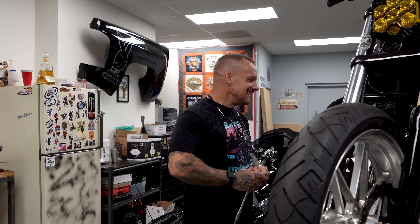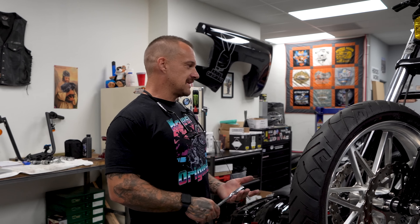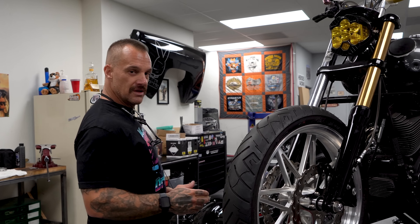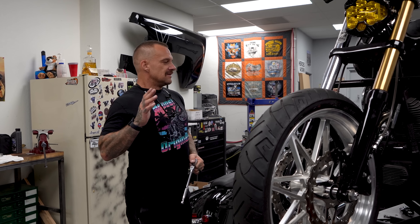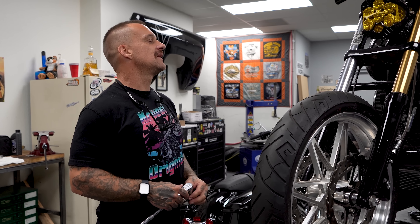It's been a process with the brakes on this bike. If you've watched all the stunt tail videos, the brakes have been a nightmare. We have a new master cylinder, Brembo calipers, new lines, new everything, and we keep losing brakes for some reason. We rebuilt the master, rebuilt the caliper, and now we're putting RBF 660 from Motul in it — it has a much higher boiling point than regular brake fluid. Hopefully that helps, because we tend to ride the brakes pretty heavy doing wheelies and I think we're boiling the fluid.